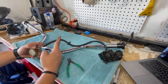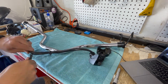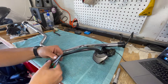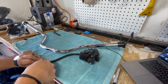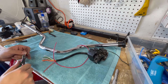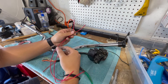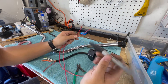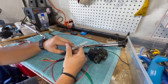The controls are a little bit short, so you're going to see me lengthen them in the whole process — it's pretty simple if you know how to do a little bit of wiring, so it shouldn't be too difficult. Since some of the wires are used twice but one is solid and one has a stripe, I'm going to grab my Sharpie and draw a line going down the wire — by doing so it'll help me differentiate between the two different colors.